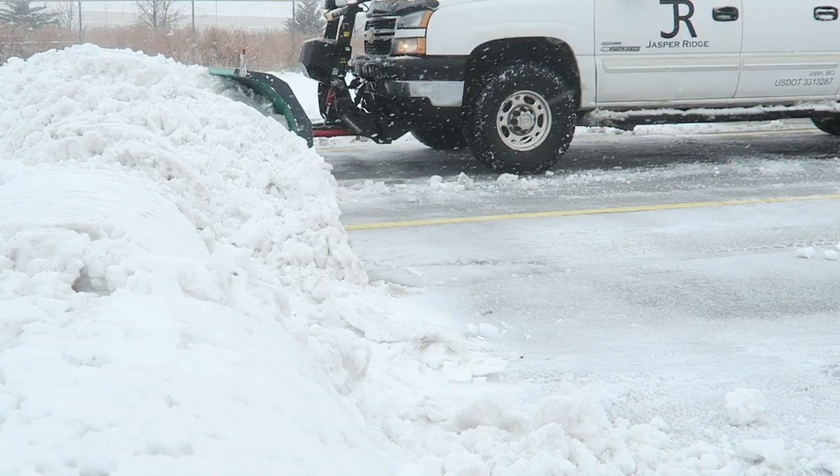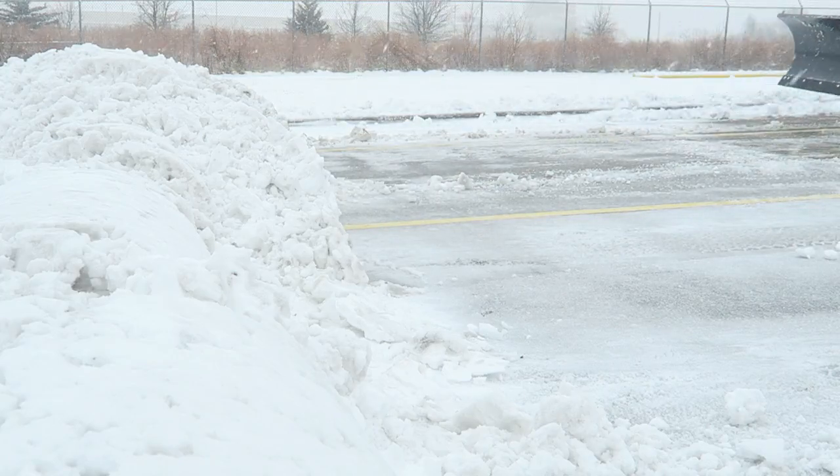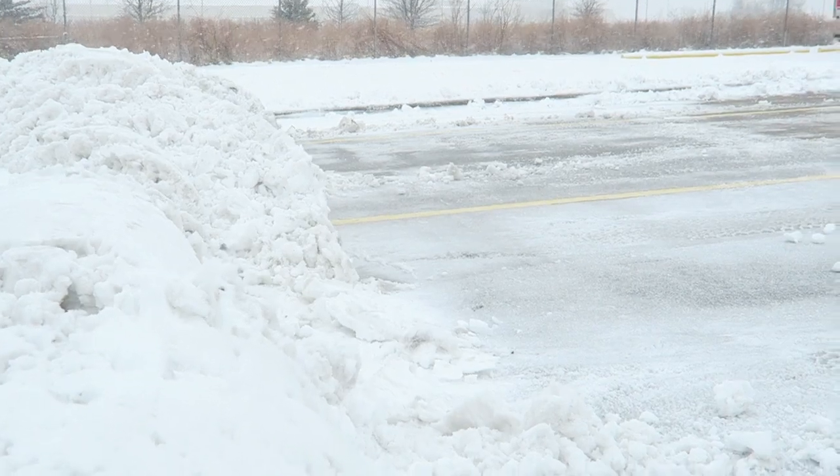And like I said, all of those mistakes that I've made: I didn't check air pressure. I went with oversized tires. I didn't get a rotation. I didn't get an alignment. All of those things are very important when picking out tires and installing tires. So do everything right, and don't take my 5,000 mile tires that could have gone 10,000 miles or 20 or 50,000 miles with the correct things.